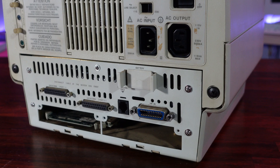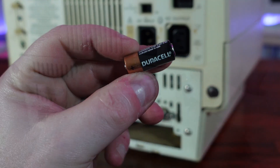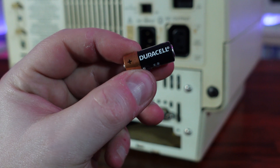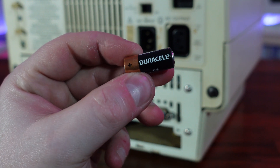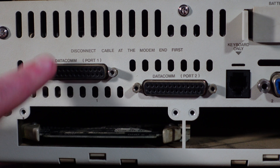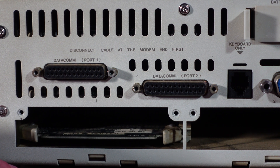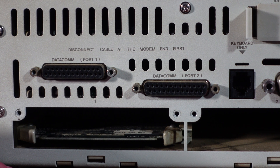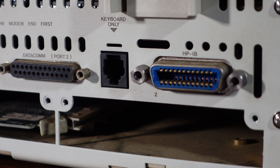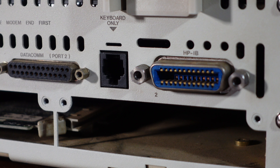Below that you've got the system board section on this back plane. There's a removable battery clip here, and this machine takes standard LR1 batteries to power the real-time clock and preserve other settings. Below that you've got two standard RS-232 ports with 25-pin connectors, with the left one also capable of supporting the newer RS-422 standard, which can transmit data at speeds of up to 10 Mbps — in 1983! You've then got an RJ11 connector for the keyboard, as well as the aforementioned HPIB connector for attaching the disk module or other compatible accessories.